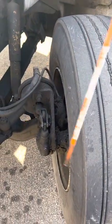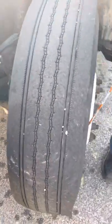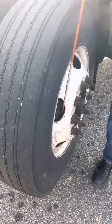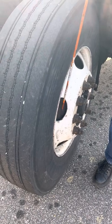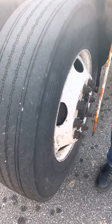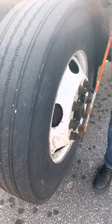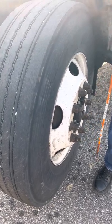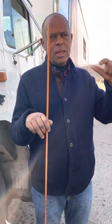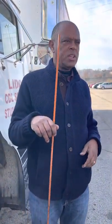This is a brake drum — no cut, no crack. And inside, make sure there is no dust, no oil, and no grease in it. Inside the brake drum there is brake lining and brake shoes. Brake shoes is the metal part — make sure it's not cut, crack, or missing rivet. And the brake lining is a pad — make sure not less than one fourth of an inch thickness, and also no grease, no oil, and no dust.